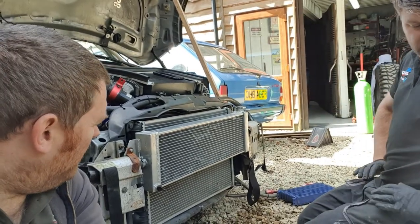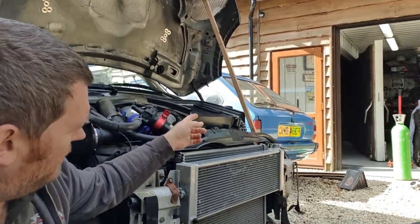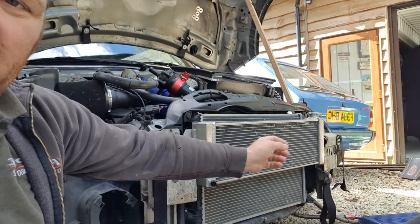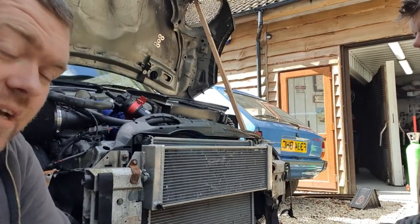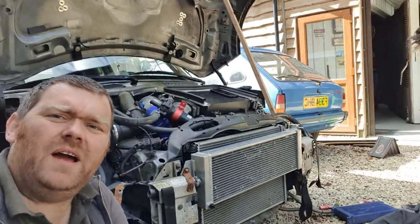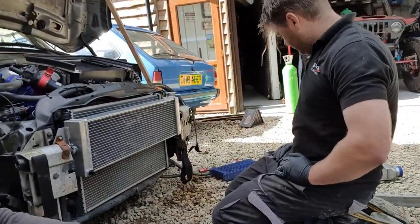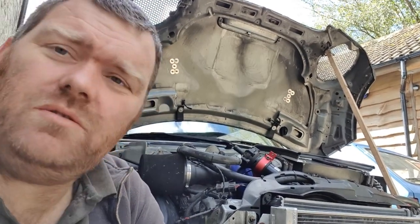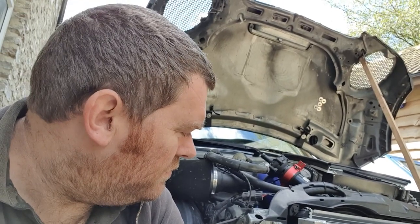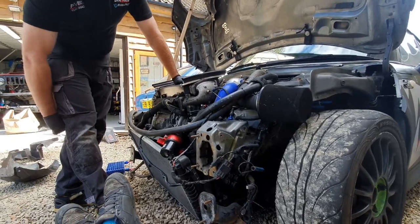The plan is to remove all this, get rid of all the plastic, get rid of my intercooler, lose this top mount, lose all this stuff, put a steel beam across here so we can mount our charge pump in a more sensible fashion. We're basically stripping a load of stuff off now and fitting our intercooler we found in the shed — top quality Toyo Sports intercooler. We found two but decided the other one was somewhat more sensible because it fitted. The video will probably jump to next Saturday when we might have some metal and start building stuff up.